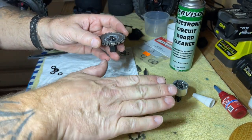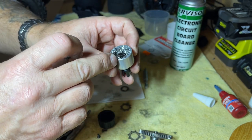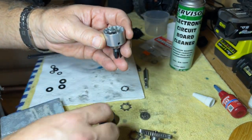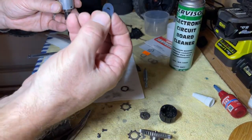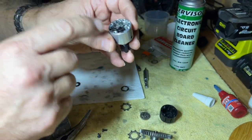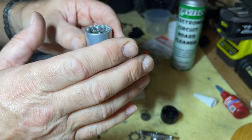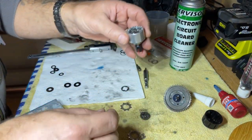On the spur gear side I went with three of the large ones — giving me another 0.4 on this side. So when I put the sun gear and all the LSD plates on this side, it's going to be such a nice tight mesh into those planetary gears that they're never ever going to slip. I reckon that's an absolute bulletproof repair for these Vitavons. For the standard ones, just shim and see how you go — get a packet of the 0.2 and 0.3 shims and muck around finding the best setting. I put them in dry first with no oil and feel how they spin — if there's a really nice feel, the teeth are meshing well.